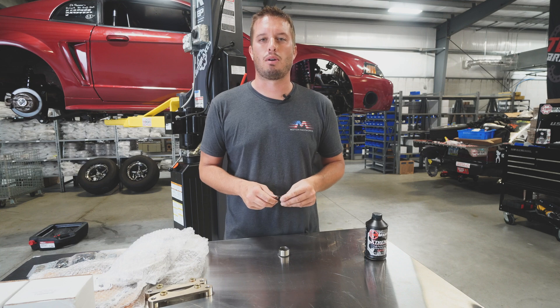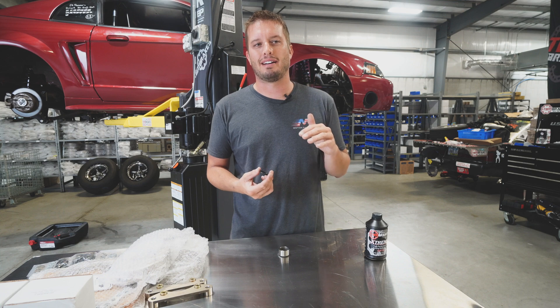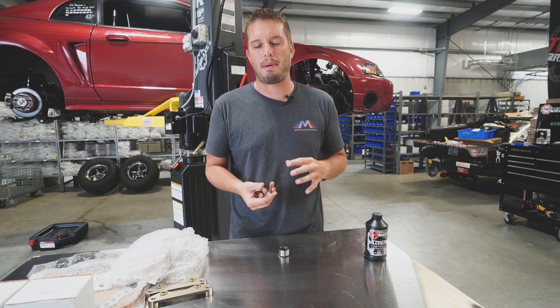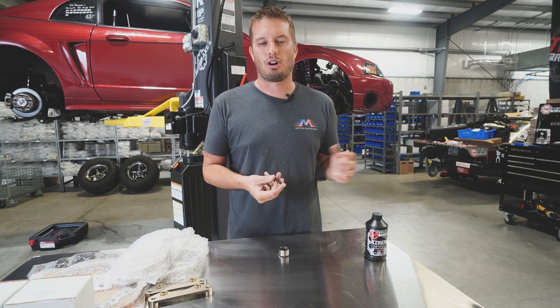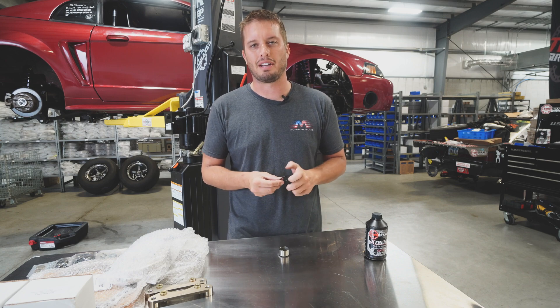Hopefully that helps you guys. There's not a lot of information out there on what brake fluid to use or not to use. It's often seen as a low-hanging benefit — thinking you'll use something that's not corrosive to your paint — but it has real drawbacks in terms of brake function, and as you've seen with the O-rings, it's not a good thing.